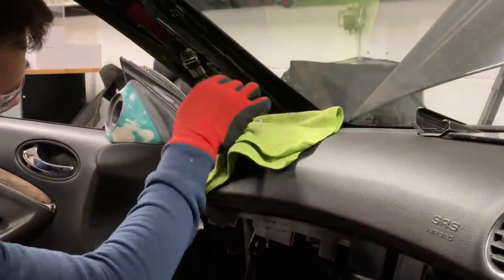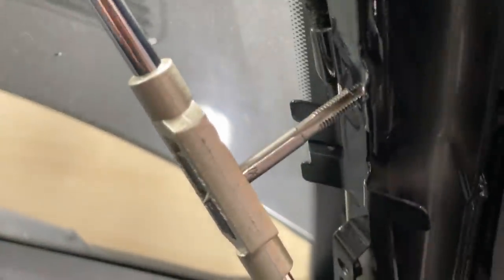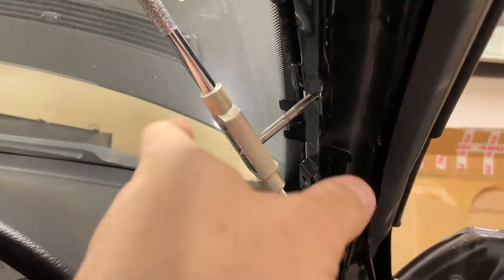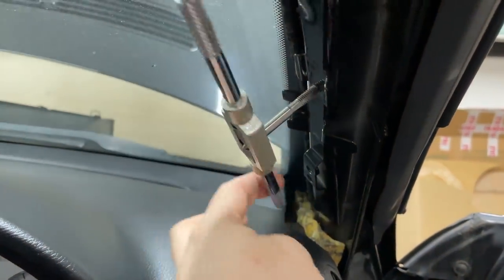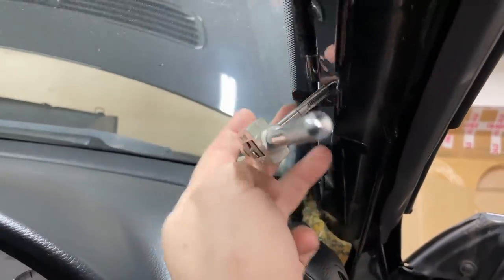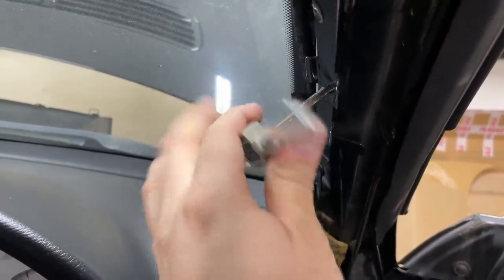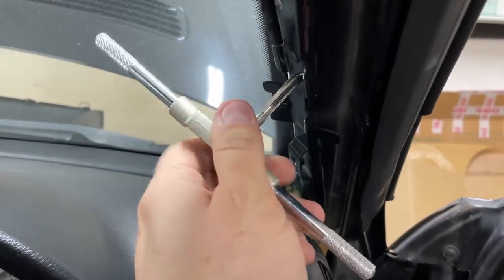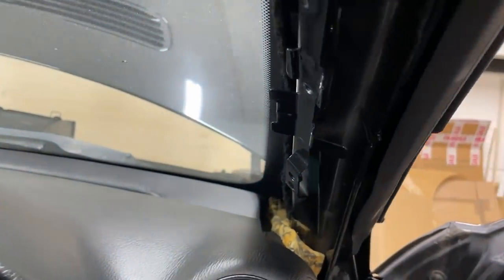Yeah. So on that side, we shave. It was there. I can show it on this side, that bracket. So that bracket is the one which is in our way. So what we did, we drilled further up. Actually, there's a box section there, and the steel is pretty thick, probably a good 4 mil. So that's why I left this in, because I tapped it up. So we have a new bolting point now over there.